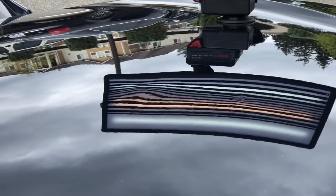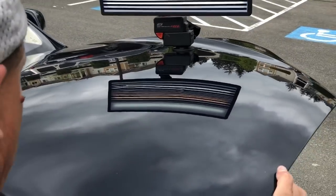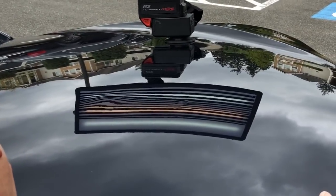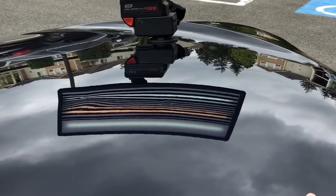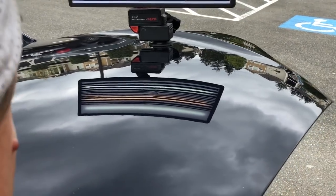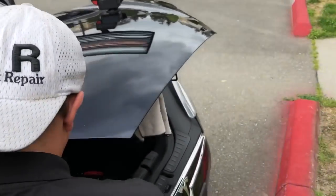And since it's aluminum, I push it up till where I know it's flat. It comes back and sits a little lower because it only stays where you push it. And then it does kind of bounce back. It has a little bit of a flex, but I wouldn't say it's a memory. I would say it's more like a stubbornness. Steel has a memory, kind of flexes around and bounces to where it wants to be. Aluminum has a stubbornness. It just sits there until you push it and won't move until you push it harder. So it's a little bit different of a metal.